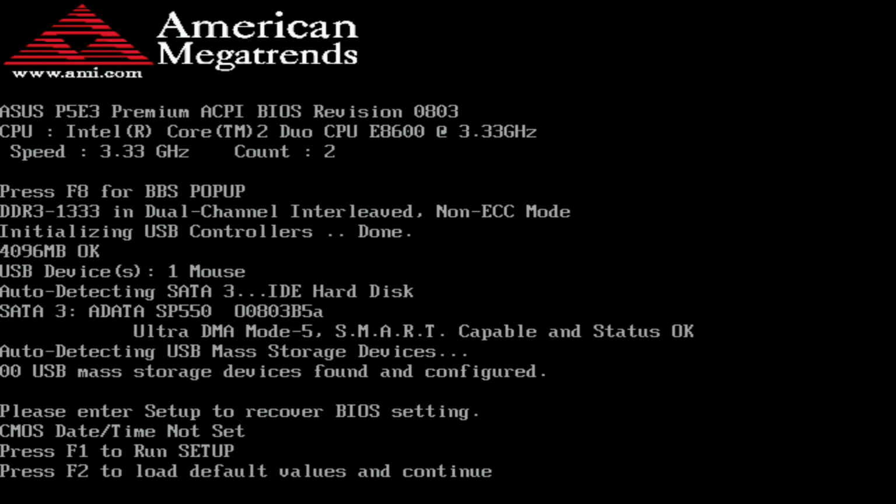But in this video we will be checking out the P5E3 Premium because it's actually a very good motherboard. Some of these can be as good as a very good Rampage Extreme, and even better than the Rampage Extreme with some CPUs, especially the Conroe CPUs, like the E6750 that I struggled with a lot when I ran it on LN2 on the Rampage Extreme. For that CPU you should be running a very good P5E3 Premium.